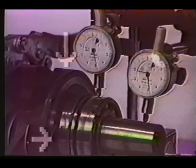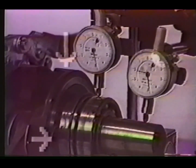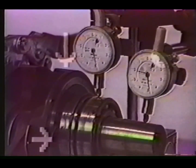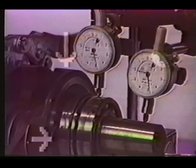The crankshaft in this position shows that the high part of the crankshaft is with the rod pin 90 degrees from the dial indicator. It will be necessary to remove the crankshaft from the fixture and strike the crank wheel where the above arrow or top arrow indicates. Using a brass hammer, hit the crankshaft wheel 90 degrees from the pin.